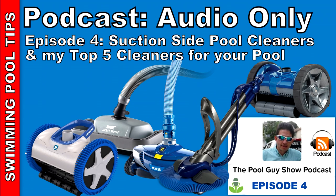They're also a geared cleaner. A geared cleaner is basically a cleaner that has a set turn cycle. So if it hits the step area, you'll see it hitting against there, and then after it runs through its cycle it'll actually start to turn — one wheel will stop moving and the other wheel will turn, and that's how it turns itself out of corners and step areas. Geared cleaners have a turn cycle programmed in and can turn themselves out of any kind of corner or step area of the pool. The Pool Cleaner, Aquanaut, and Phoenix are geared type cleaners, which I prefer on my pool route — they never get stuck in any areas in the pool and they work very effectively.